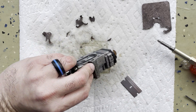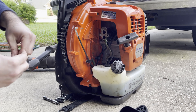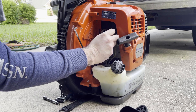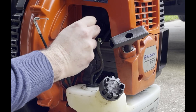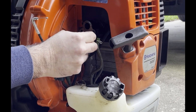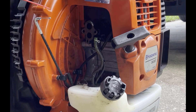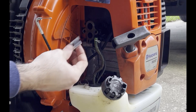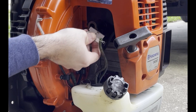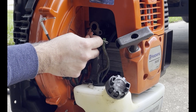I'm going to use a regular old razor blade — just be careful not to gouge the aluminum housing of the carburetor. If you want to ensure you don't gouge the housing, you can use a plastic razor blade and be a little more aggressive. You don't want all these shavings to go into your engine when you put the carburetor back on, so make sure you spray that out good. Nothing like a little carburetor cleaner in the face first thing in the morning. Same thing on the engine side — get this gasket off. Try not to get anything in these holes — that's your intake and it goes right into the engine. Spraying it with carb cleaner helps break down that gasket. If you gouge the metal, that's a place for air to leak through — we don't want that.